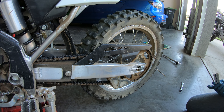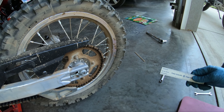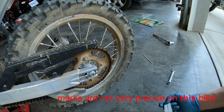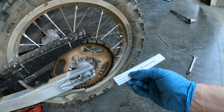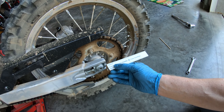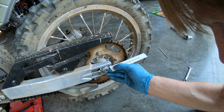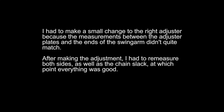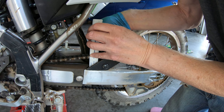I need to verify that the rear wheel is in proper alignment because I don't like these adjusting marks — you can get a ballpark but they're not very precise. What I prefer to do is measure from this plate to the end of the swing arm. Getting in the center there, it's almost exactly nine millimeters. I'll measure on the other side as well — nine millimeters as well. Double-check the chain slack: 37 millimeters. That's pretty good.